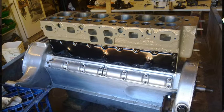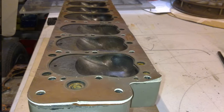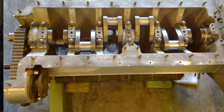Well, the engine was actually stripped by the previous owner, and I'd checked it all and realised that she was in a pretty sad state, so I had to get new bearings poured. They were the old bearings from the old days where they had the bronze backings and then the white metal poured into them. Then it has to be line bored to a new ground up crankshaft, a cleaned up crankshaft, which was all scored and rusted and pretty buggered.